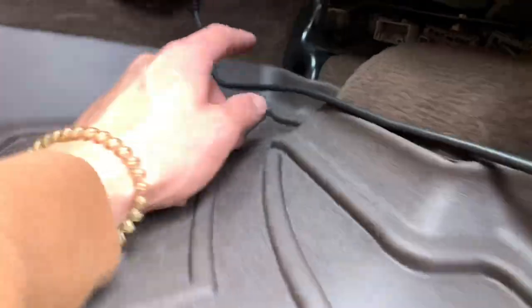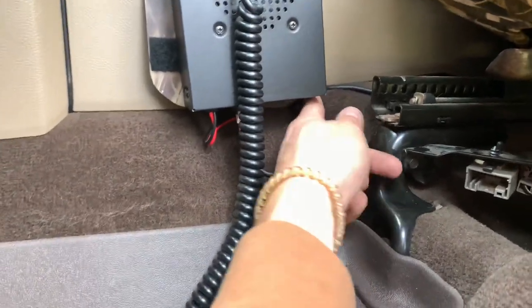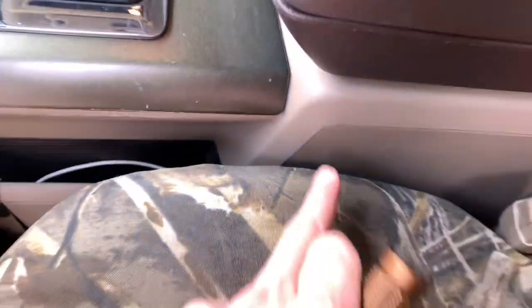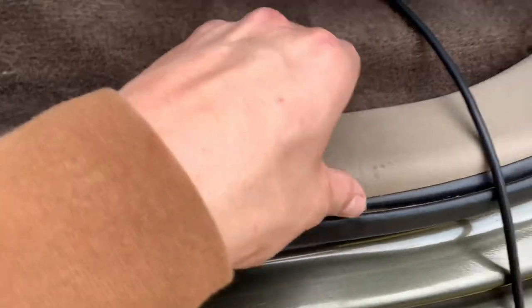First thing I'm doing is hooking the wire up to the CB. I got it stretched out — I'm gonna pull my tag in back there underneath the seat and around. I'm gonna run it through the carpet right here, come out, follow that trim and go back. Next I'm gonna feed it underneath that plastic — if you push the plastic out you can get that wire under there real easy. There's a piece of conduit — I just ran the wire in the conduit, it goes back there behind the plastic.